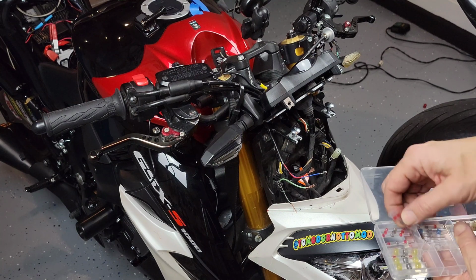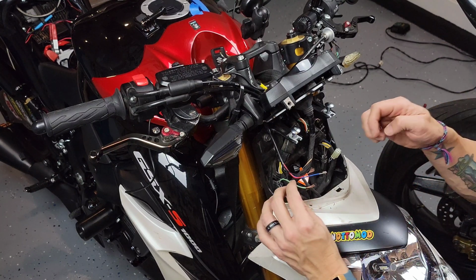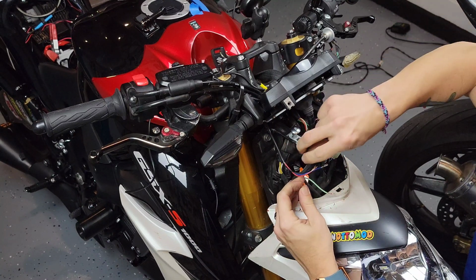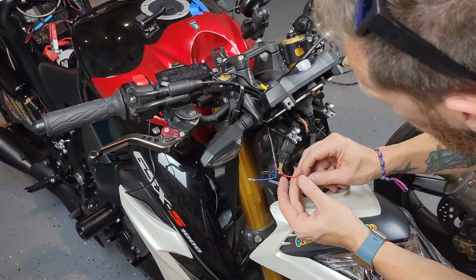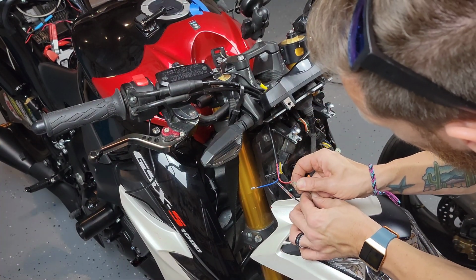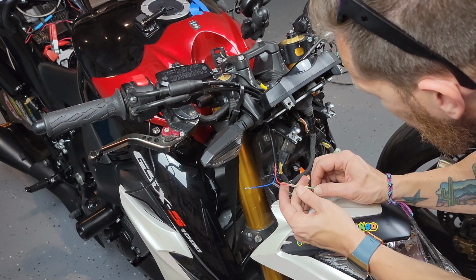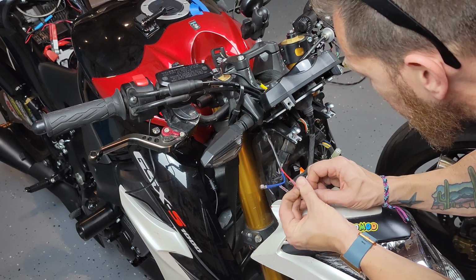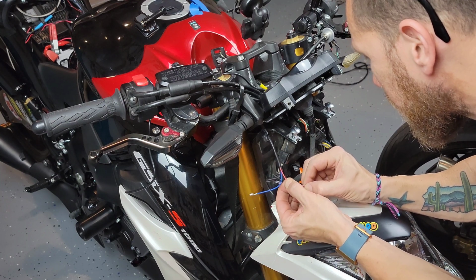Okay, with the cables exposed, now I'm bringing my heat shrink things, where they solder at the same time they act as a heat shrink. Just picking the sizes that I'm going to be using. At least I need 2 for this connection. Okay, so I have both cables connected, establishing the connections right here. Remember, you have to put the heat shrink on before you do the connection, so that you can slide it through once the cables are joined.